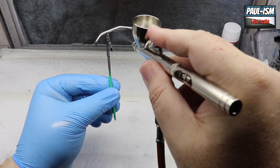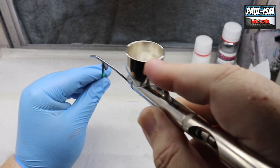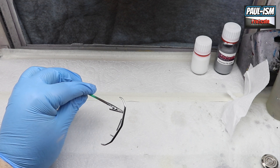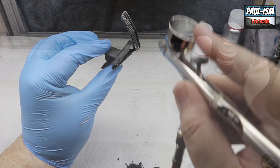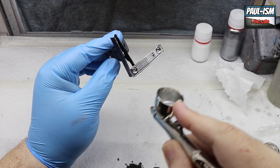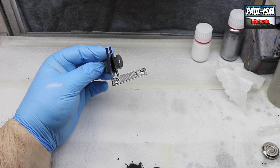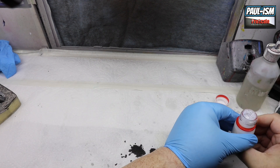There's the third coat on the rear bumper — looking absolutely fantastic. Apply a third coat on the front bumper as well, going with very fine mist coats over the top, front, underneath, and behind. Do the same on the grille for one last coat. The chrome dries super fast — it literally flashes off before your eyes. After three coats on each part, they need to be left for 30 minutes at about 20 degrees centigrade (typical room temperature). If it's colder, leave it a little bit longer.